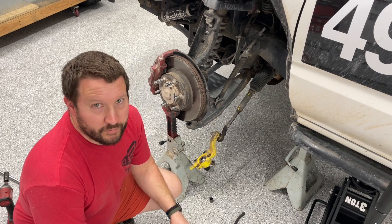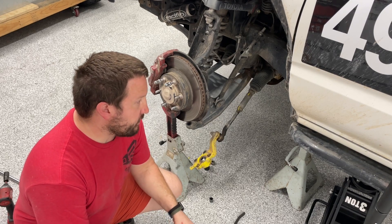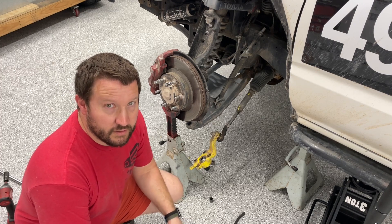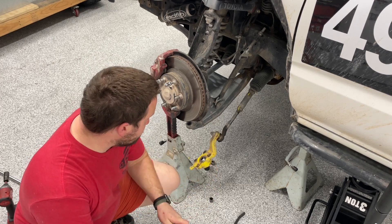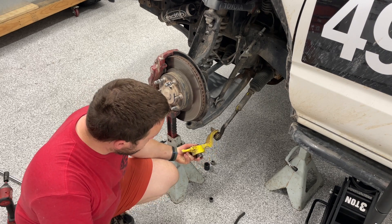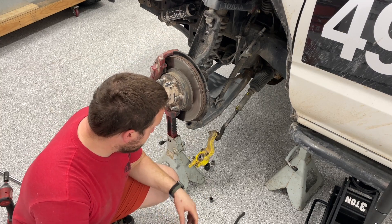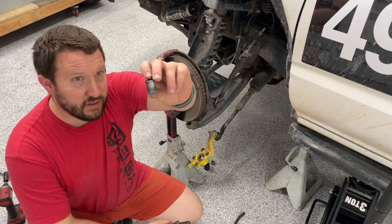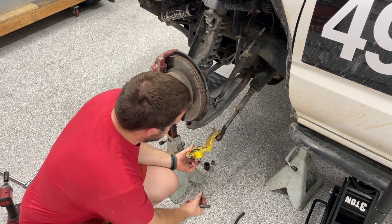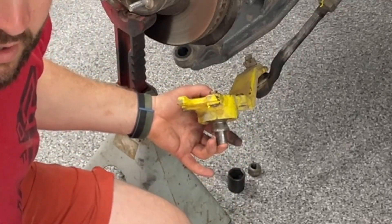For people who are familiar with the infamous Toyota lower ball joint failure, you know what I'm talking about. I looked underneath the truck and it turned out the ball joint itself was fine, but I've done something unique to these — I actually swapped them out to be lower uniballs, so they have the same kind of uniball setup that is up here on top. Different misalignment spacers and stuff, but still. The difference is I have an Inconel tube on the bottom of the misalignment package, and it provides shear strength at the corner of this interface right here.